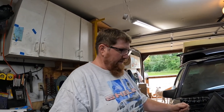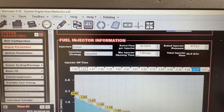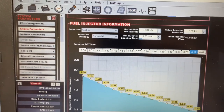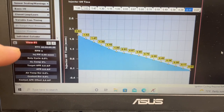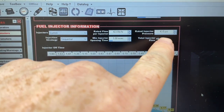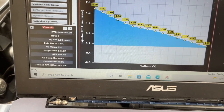I'm back and I kind of figured things out. I figured I'd have to do a custom injector setup. I watched a video by Leach — he's got really good information and goes really in depth with this stuff, which is important, but not for what I need for just starting this up. What I had to do is put custom up here, bring this up to 42 pound, and this is my fuel pressure right now. I had to take the data card from the injectors — it tells you the voltages at the bottom: 8, 10, 12, and 14.